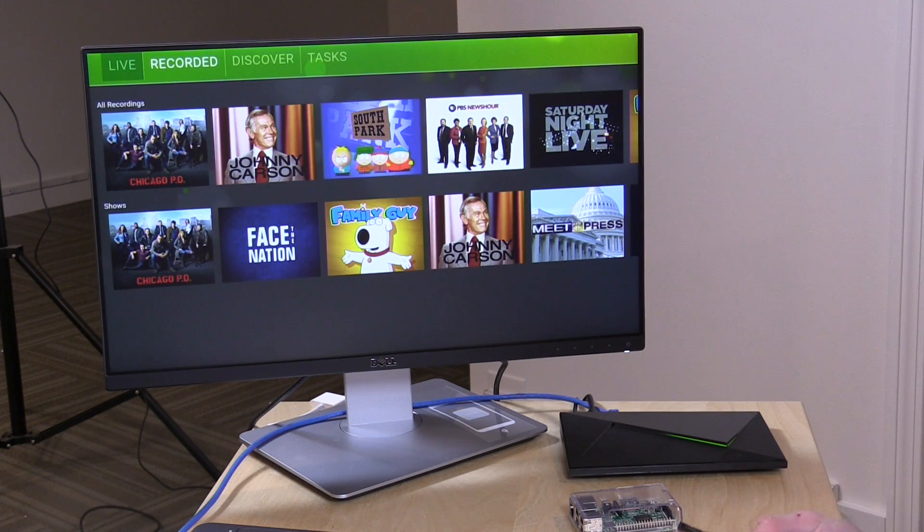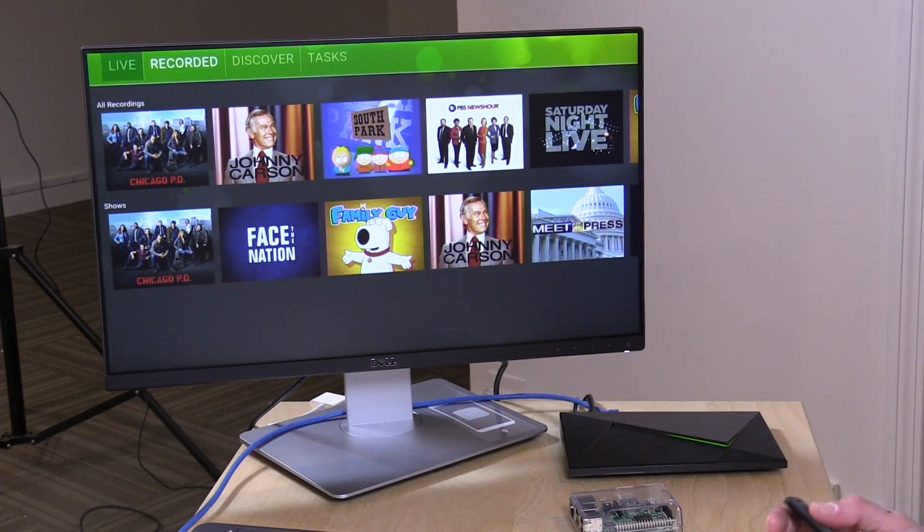The recording engine can be run on other devices too, like a Synology NAS drive, a WD My Cloud, or other brands of NAS drives. You can run it on a computer too, and then just run the client on here. They do recommend only having one device on your home network running the recording engine, because it goes out to their server to get its list of tasks — otherwise you'll be duplicating recordings and wasting tuners. You can use multiple HD Home Run tuners with it, and it will smartly balance out the load.